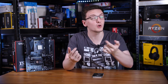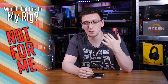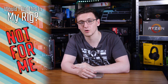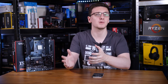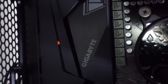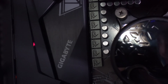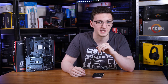So should you buy one of these motherboards? I think the short answer is probably not. Unless you're desperate for PCIe Gen 4 support and can't afford a higher-end X570 board, I really don't see much of a use case for this board when X470 boards are currently still plentiful and readily available — especially now that they come with BIOS updates that make third-gen Ryzen work immediately. Generally, I'm having a hard time finding a use case.